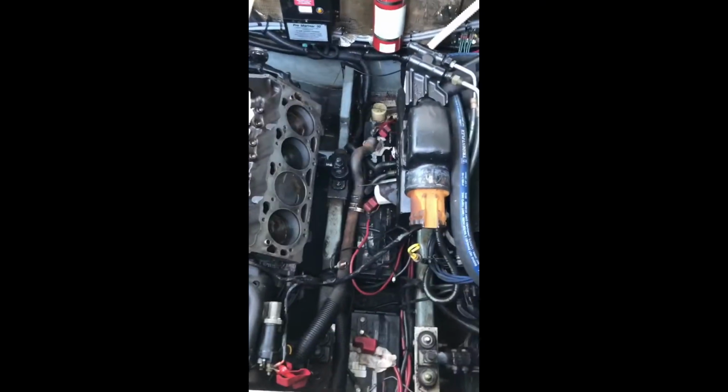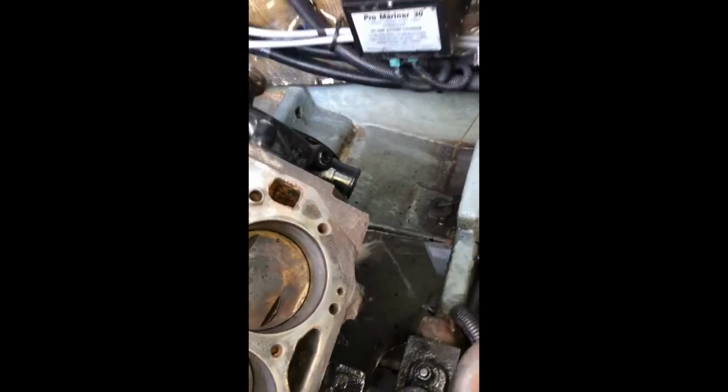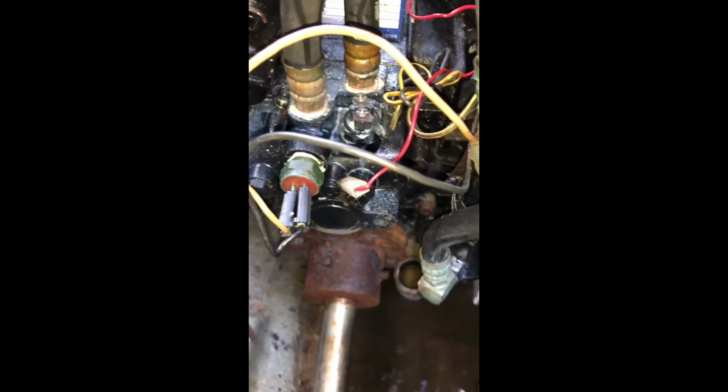Wow, guys, in the video that I just did, I talked about how the boat picks up water from the ocean through this line. It goes over there, comes to the water pump, right? That's gonna be somewhere right there, and it comes back and passes inside 2 heat exchangers, one for the oil of the transmission, and one for the oil of the engine. So 2 heat exchangers. So the water that passes the water pump, look at this. There's like all kinds of stuff in there. See that?